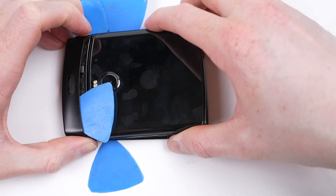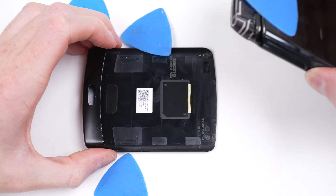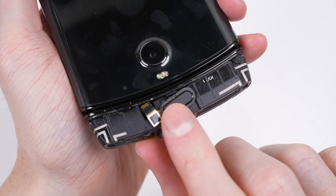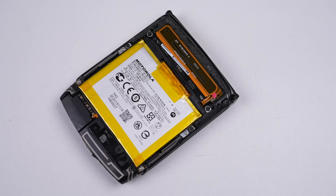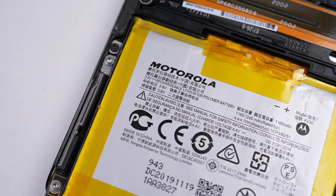This is one of the criticisms of this device in iFixit's teardown. This setup reminds me of Apple's iPhone 5S and SE. What's different on this phone is that the sensor can be freed without unplugging it — it's only attached to the rear panel with wide adhesive, so I was able to push it free. With such a recessed connector, I can understand the criticism, but I don't think unplugging it at this stage was the intended way of disassembly.